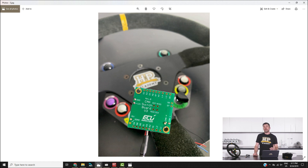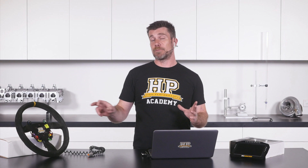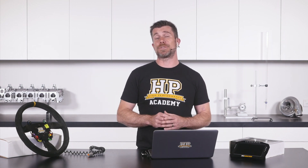It creates CAN messages, so we need to do something with those CAN messages so that the ECU can understand them. If we were communicating directly to our M150 ECU, this is actually a little bit tricky because in stock form the CAN message needs to be in a very specific form for the likes of traction control and launch control switches — it can't talk directly between the ECU Master CAN switchboard and the ECU. So what we're doing is that information from the dash goes into our MoTeC C125 dash, which is really configurable by the end user in terms of the CAN template. We can read all of that information in from the switches and analogue voltage inputs, then send it out in the correct form for our M150 ECU.